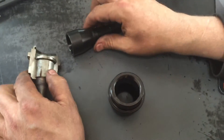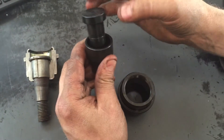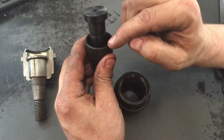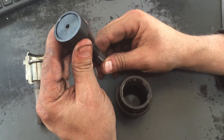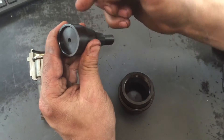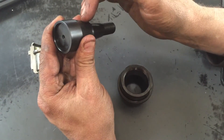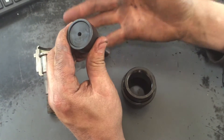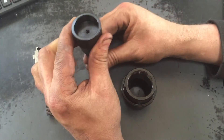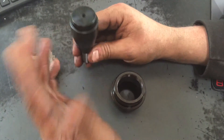With ours, the head and the main shaft have the same clearance between the upper chamber and the lower chamber. The upper part is supported by the wall from the upper chamber, and the pin is supported in the lower chamber. So even if you have a little bit of play, when you bolt your knuckle up it's going to be very solid and it's going to turn really nice and smooth. You won't have any play. Thank you.